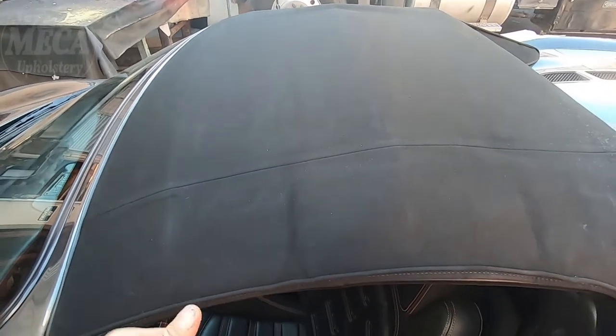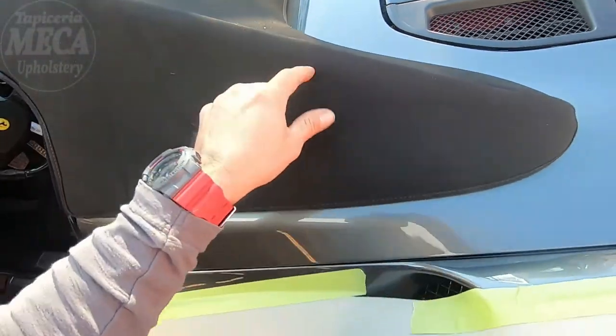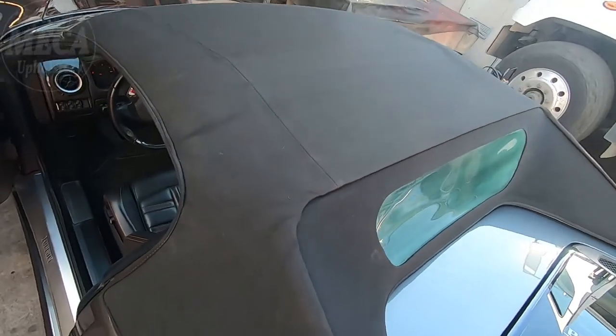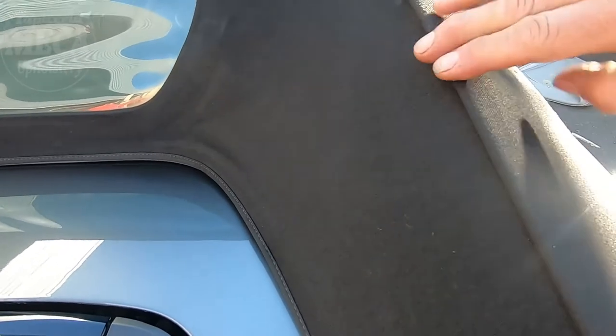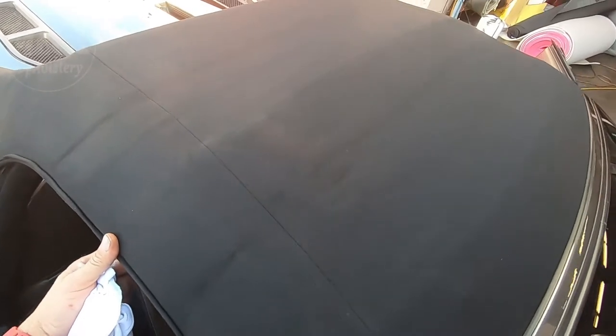The top is closed. It's a little dirty — I'll clean it and apply a special protective liquid to make it look nice. I check the passenger side — that's where the problem was. And you can see now, my friend, that part is tight. The problem was the broken spring loop on the cable. Now I connected it and it looks like nothing ever happened.